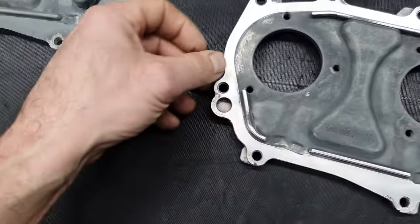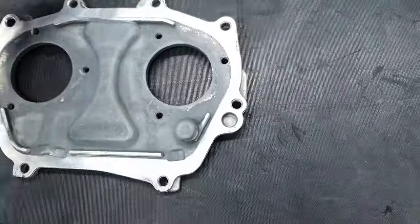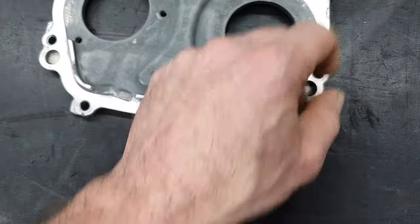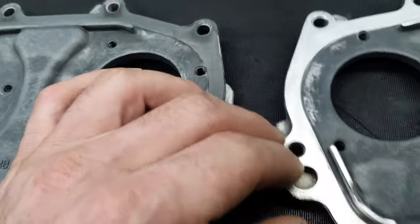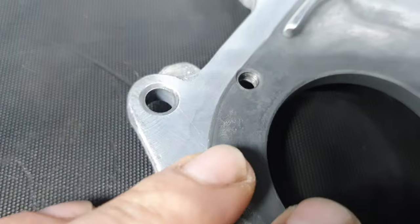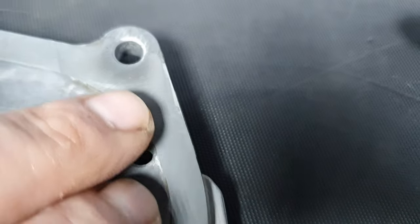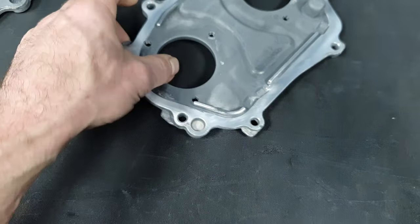And again, you're not gonna get 300 grade sandpaper and start removing from the surface. You're gonna get, let's say, 1500 with a little bit of soap and water, and you're gonna go nicely, slowly, all around. And the machining lines that I'm saying, you can still see. You cannot see with a stupid light. I don't know if you can understand what I'm saying, that I can see this, the machining lines. I'm talking about this one, what you see here. It's only, let us say, like a powder that you remove from the surface.